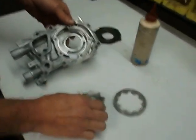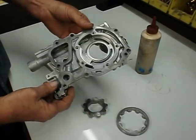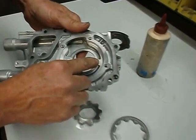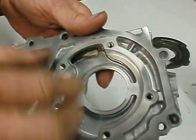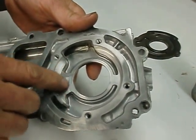First, you have the inner rotor, the outer rotor, and the pump housing. This is a number 10 pump that is actually bad. The key point of what we determine to be bad is the scratching right across this area. This is the low pressure side, this is the high pressure side — all the magic happens right across this surface.